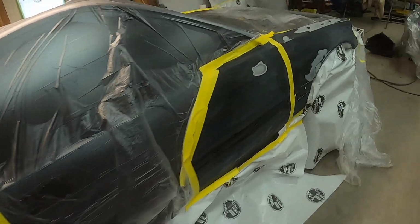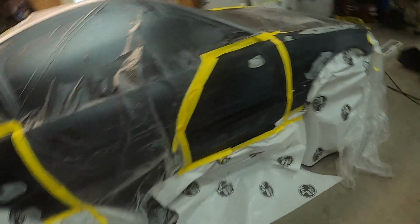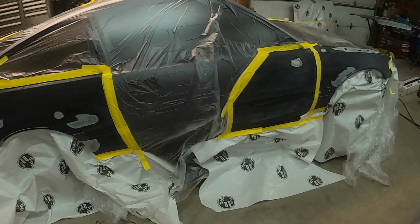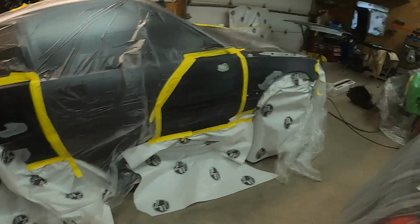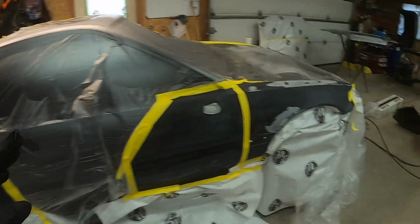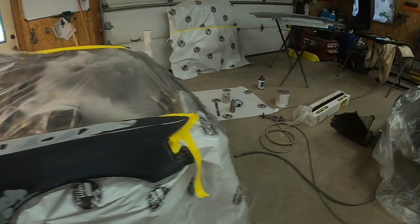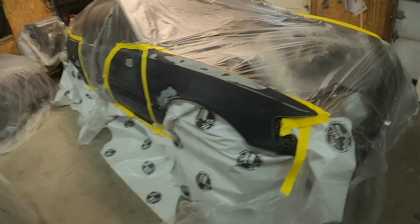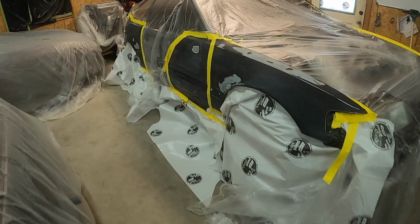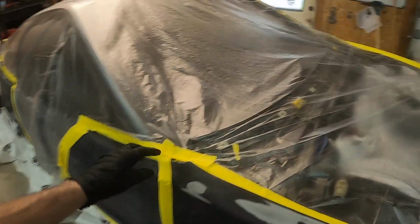The sprayable polyester, it's good for bodywork, but it is quite tough to sand. So keep that in mind if you use it. You're gonna have to prime it again. So we're only doing this for the bodywork areas. And then on the final prime, we'll prime it black so that when we go to paint it, it's already a good shade to put black right over and make it a lot easier when it's in the booth.